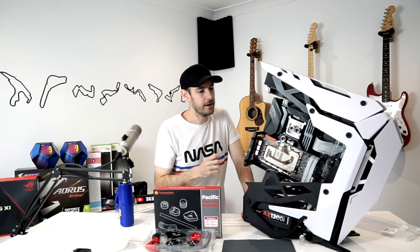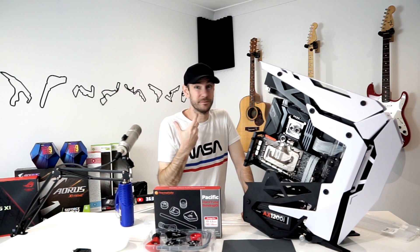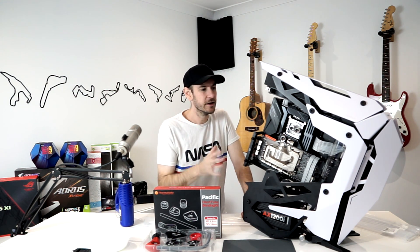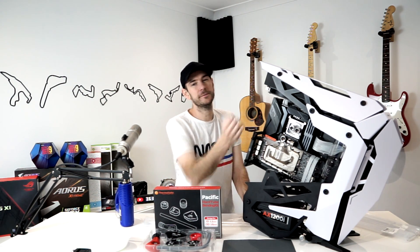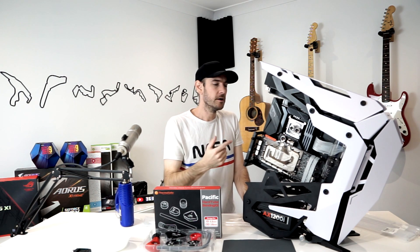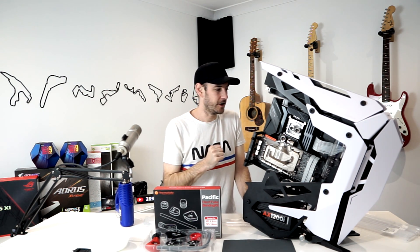The only thing that does matter is that your pump is immediately after the reservoir, that the pump sits at the lowest point in the case, and the reservoir sits at the highest point possible. The reason that's important is because it makes filling, draining, and bleeding air a lot easier. Once the loop is established and water is circulating, it doesn't matter. Systems with massive uphill runs in the loop can be really hard to bleed at first and get the air out, but once it's flowing the pump works the same regardless. I wanted you guys to understand that before we start bending the lines.